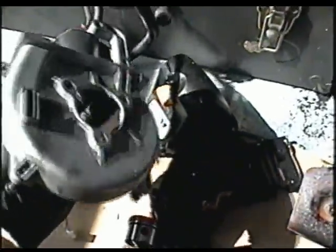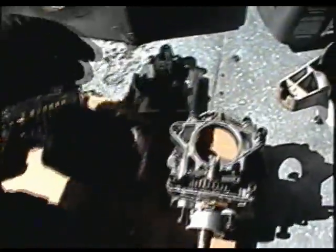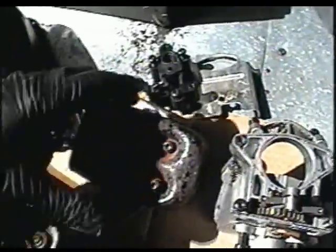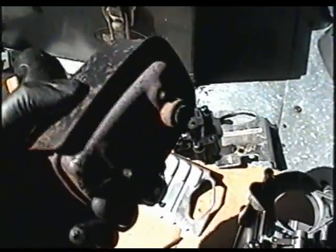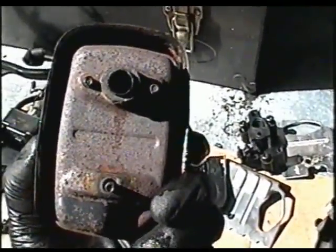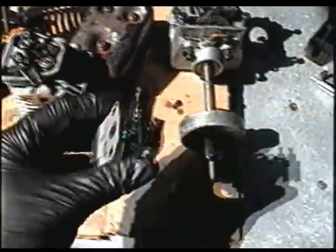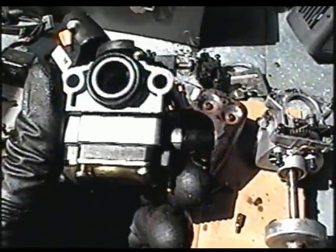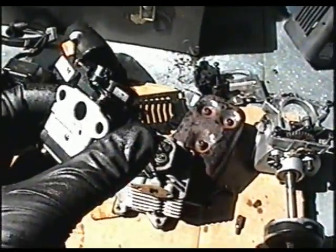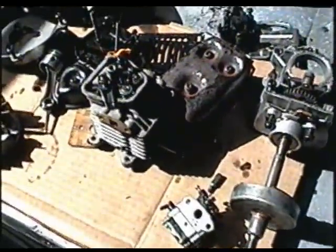There's the ignition module — I kept it on the part so I wouldn't lose it. There's the adapter for the carburetor and the muffler. It's pretty big so it makes them a lot quieter. And there's the recoil. There's the carburetor — this is a Walbro WYL carburetor. If you need a kit for that, it's a K20-WYL or D11-WYL.